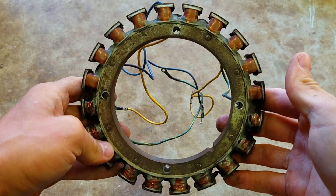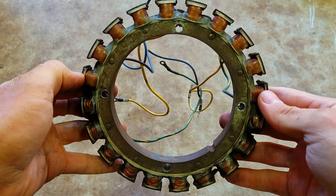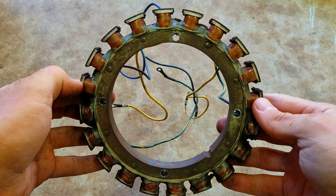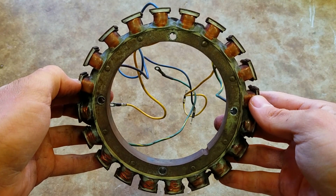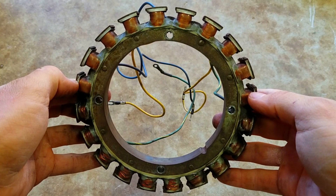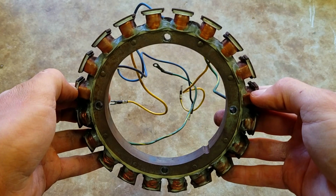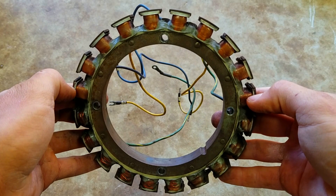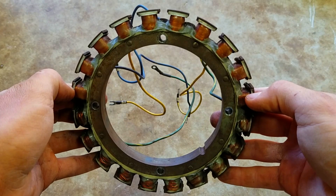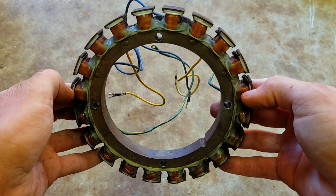These stators are comprised of two different sets of coils: there's the charging coil and then there's the ignition coil side. Your ignition coil might still be good and your charging coil could fail, and then your battery wouldn't charge but your ignition would still run properly. They can also fail in reverse — your ignition coil could fail and your spark will be all messed up, while your charging coil might still work and your battery will stay charged, but your ignition will have misfires or no spark at all.